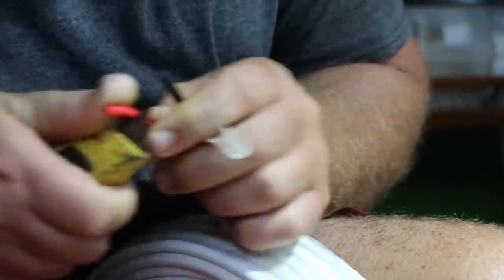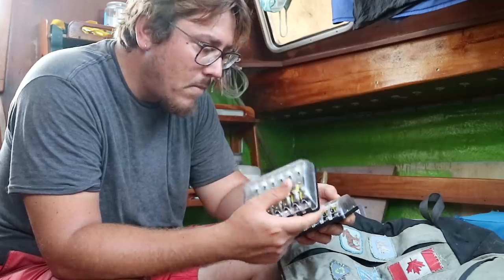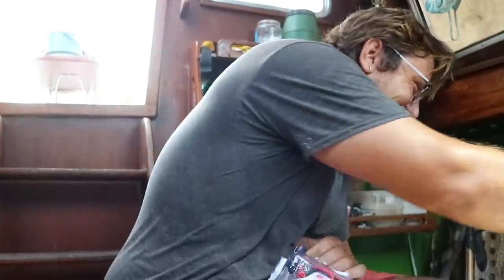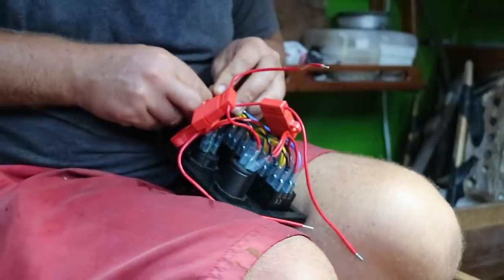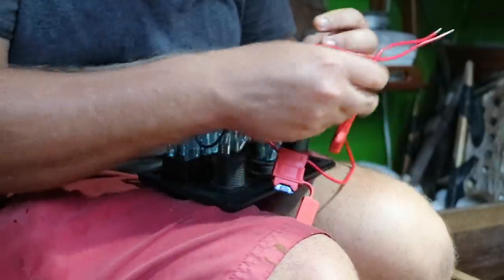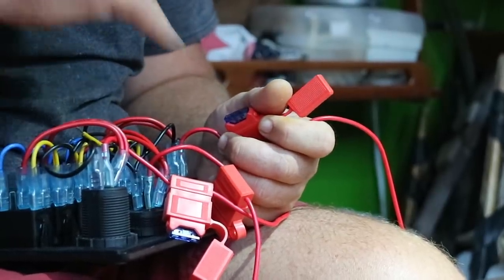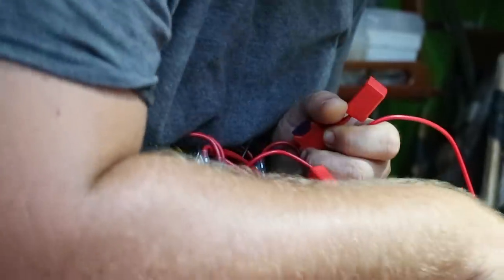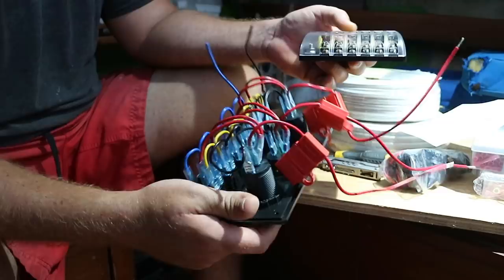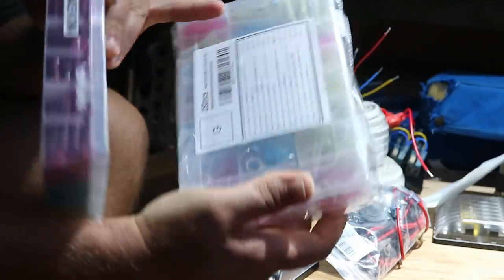Thanks to our patron Brian, along with all the other electronic stuff he sent us — fuse panels so that any electrical shorts won't result in a fire, as well as an entirely new switch panel because our old one has wasps growing in it. This one comes pre-wired with fuses. Usually you can't see if they're broken from the top, but these ones you can — they get kind of milky white inside when they bust. Nice new crisp electrical equipment to keep the upcoming system safe.